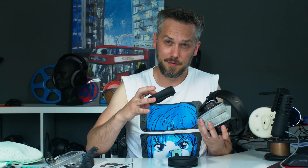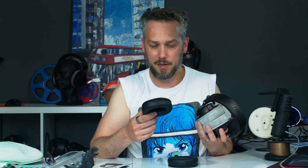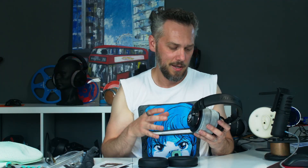With the leather pads the sound was pretty good — not too bright, fairly flat mids, with a bit of a hump somewhere in the mid-bass, and then the bass rolls off a little. I think these are designed for maximum isolation, so when you're DJing or playing drums that hump in the mids probably helps the kick drum come through to keep you on beat. For more critical listening, I think the velour pads are the way to go — flatter response with a bit more sub-bass, which is what you want from a headphone.